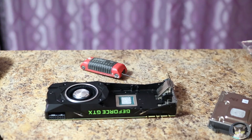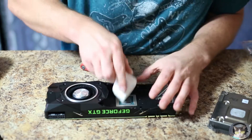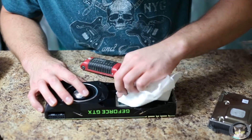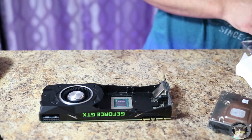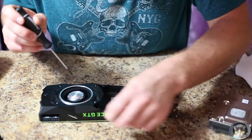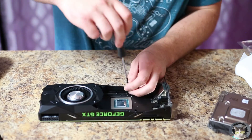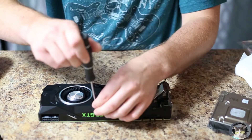I did end up using the thermal paste that came with the hybrid kit, and since then I've replaced it a couple of times. The first time I actually over-tightened the mounting screws for the pump. It was a little snug when I removed the pump later because my temps didn't seem cool enough. When I took it off I noticed the paste had been squished out a lot, so I think over-tightening was the cause.